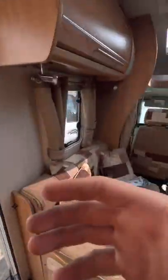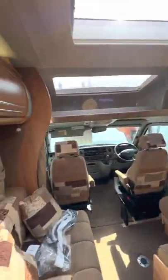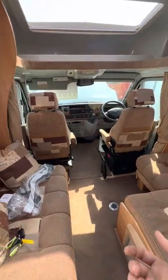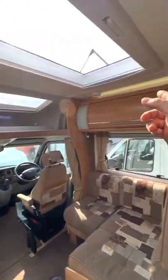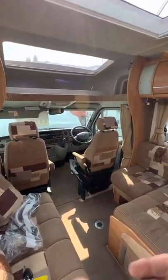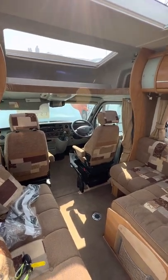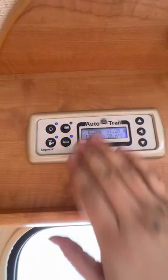This button up here switches between power sources — basically if I turn these lights on, all the lights over the top of the cabinets come on. At the moment it's all being powered by the leisure battery. But if I press this button, all the lights are then being powered by the vehicle battery, which for obvious reasons you don't want to do because eventually it will drain it and you won't be able to start the van. So you don't want that one on — just those three on, then you can go ahead and start using the van.